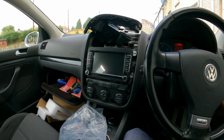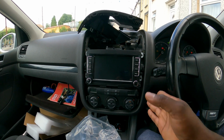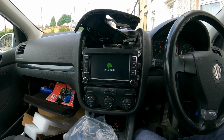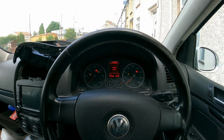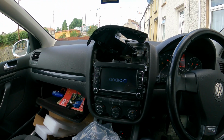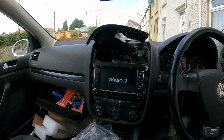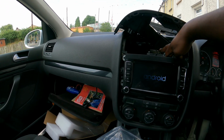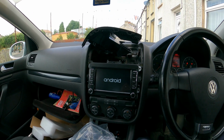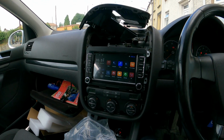So let's start ignition and cancel this indicator. There we go. And as I said, because I unplugged that, I got an airbag fault, which is no big problem because I can always plug VCDS and clear it. But yeah, actually the airbag fault is because of the light that I unplugged, because it doesn't close the system and throws the airbag light. But no, it's not a big deal. I can always cancel it.